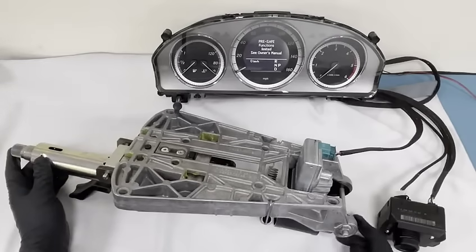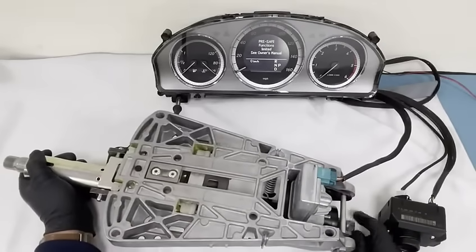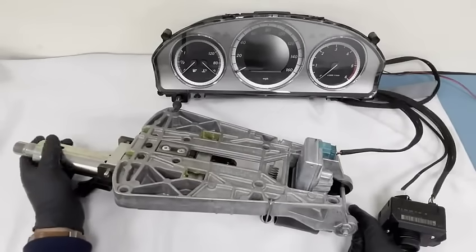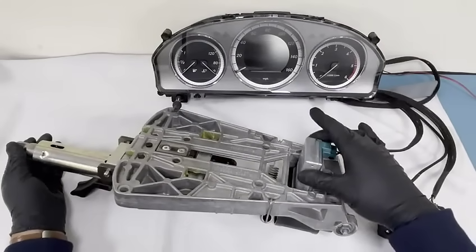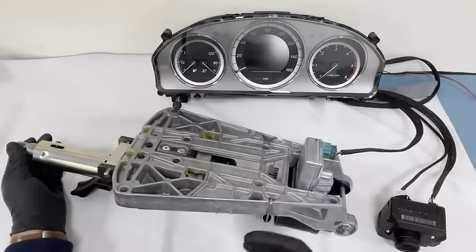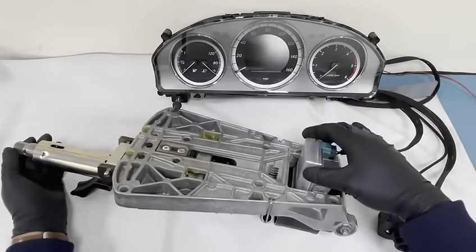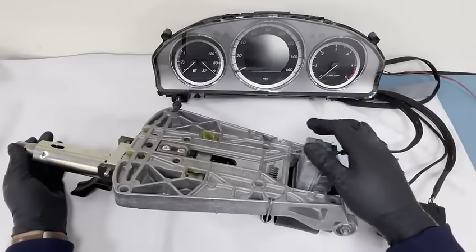This is the spline here — that'll be connected near the pedals where the knuckle joint is. Here we have the steering lock, which is fitted on the column. From underneath where you go to the pedals and look up, you can't actually see this. It's bolted up — I think they've done that for security so no one could get to it if they want to steal your vehicle.